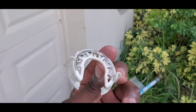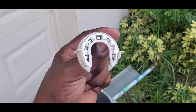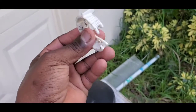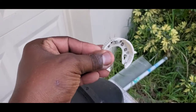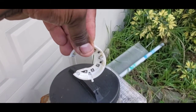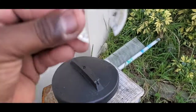This is the locking mechanism that goes around your HID lights — the part that screws onto your car to keep your light bulb attached. This horseshoe-shaped part goes in just like this: you put it in counterclockwise, and as you put it on there you twist it clockwise and it should lock in place.